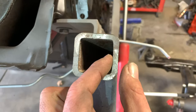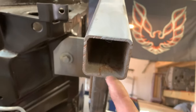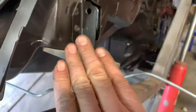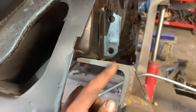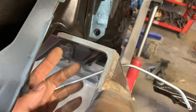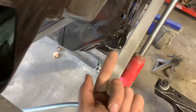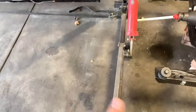Up close here, this is two-inch box tubing — I had some thicker stuff. The thinner gauge down here is probably sufficient to build what we have. Now how it attaches to the body: this is your body mount right where the subframe attaches. This chunk of steel was a nice angled piece we found heading to the trash, with nice holes already in it so I just reused them. I added some gussets for more strength. This is the third car I've used it on and it works out really nice — it's tied to the body using the factory cage-nut body mounts, very secure.